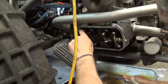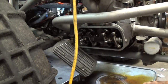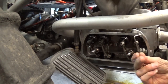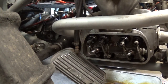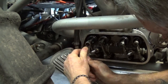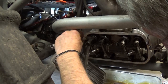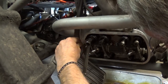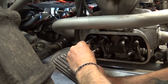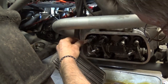On this particular adjuster it's set up for Allen screws — these are my old Gene Berg adjusters. Here's the Allen wrench. Just going to stick it in, loosen it just a tad, snug the nut back down, and loosen it up for him. That's why I like these little adjusters. That's even better.